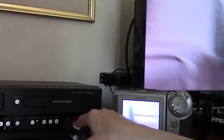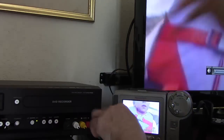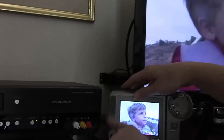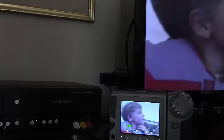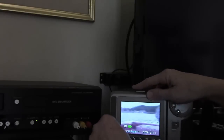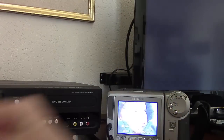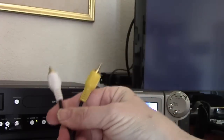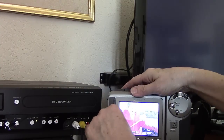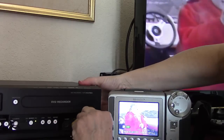When I try different combinations to find the audio input with the yellow and red plugs, I don't have success. I figure out it's the output connection to the camcorder since it isn't the original cord. Once I fiddle with that AV output, I find I can get audio and video just by wiggling it around. The red plug doesn't do anything since the camcorder is mono. I then try a cable with just two inputs — yellow and white — switching them, putting white in yellow and yellow in white. But it doesn't work. With the two-prong cable, I put yellow in yellow and white in white, and I have audio and video from my camera.